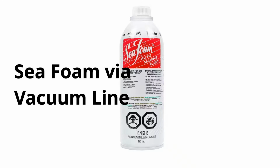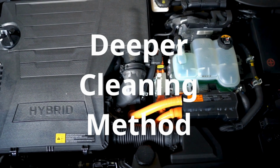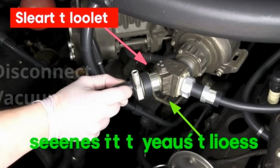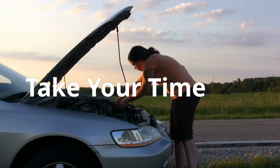Now moving on to number 2, use Seafoam via the vacuum line. This method reaches deeper into your intake system and loosens gunk your rag can't touch. Here's what to do. With the engine running, disconnect a vacuum line that leads to your intake manifold. Slowly pour Seafoam into the hose, just a little at a time. Take your time. Rushing can stall the engine.